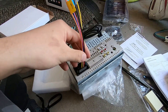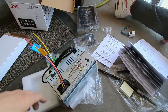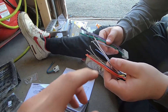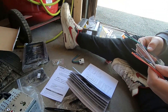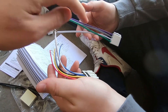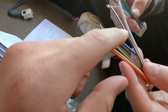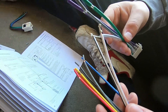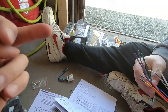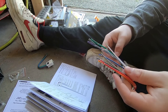Now it's just take your time with the wires. What Brendan bought is the radio, the dash kit, and a separate module that hooks up directly to his car. The ones that came with the radio and the Nissan/Infiniti module - it's pretty much just color-to-color connecting. Black and white goes to black and white, and so on. Just take your time; there are directions with it and also directions on the Nissan/Infiniti module.